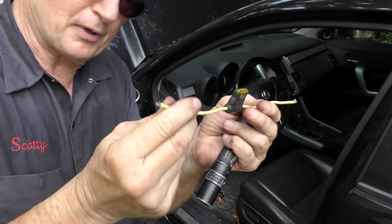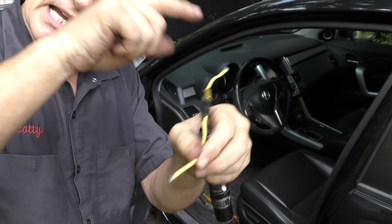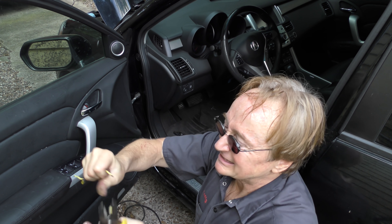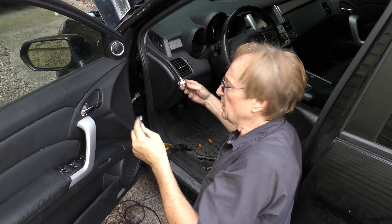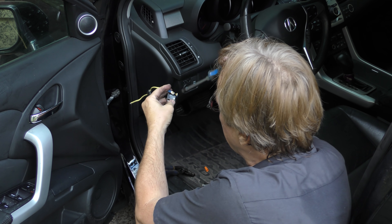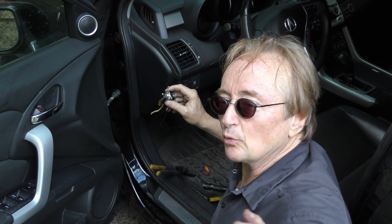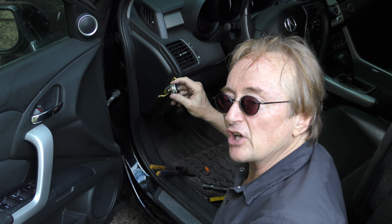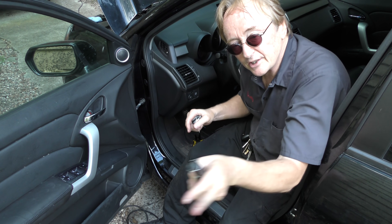On the other side, like I said, we're going to put a 20 amp fuse — same as the fuse that was in it. So we'll just connect this wire to the switch and then the other wire to this inline fuse holder. We'll strip this end a little bit more, put the little eyelet in the hole, clamp it down just like the other one — now it's nice and tight — and we'll screw it onto the switch. Then we screw that end in. When you turn the switch on it'll let power go to all the things that weren't working, but we connect that wire to the black wire so now it's a complete circuit.